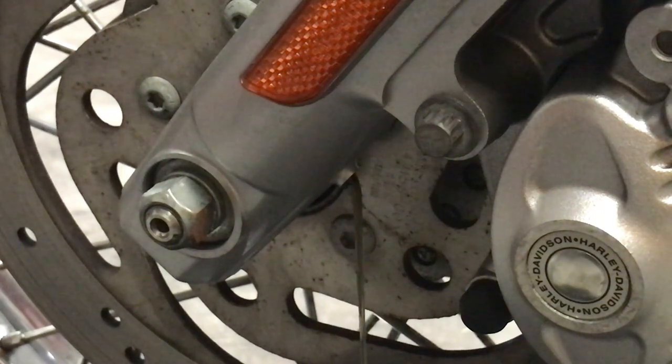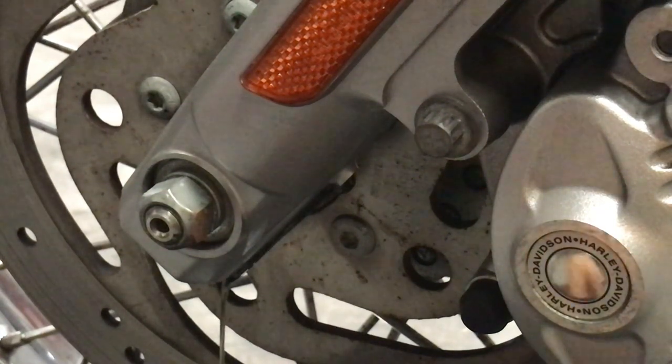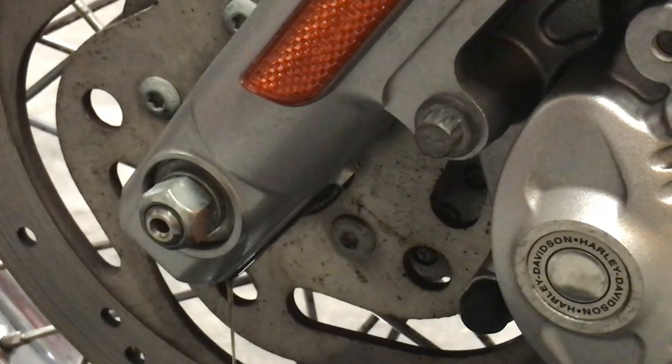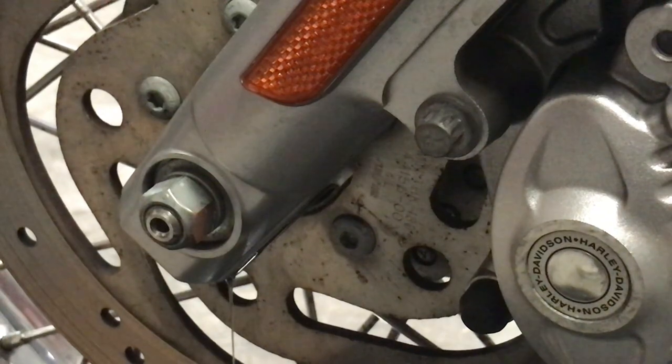Before I tried squeezing the fork down — it didn't make a difference. All it did was make a little more of a mess. As long as that cap's off the top, the drain plug is open and the stuff is coming out. Let it drain for a few minutes, pull the spring out tight end down, put it in the bag and you don't have a mess. That's why I put pretty much 10 ounces — it asked for 10 and a half, I put 10 back in. That's what it drained. It's probably a half ounce in the system somewhere.